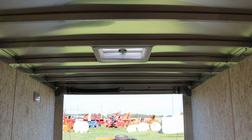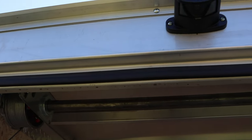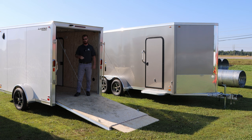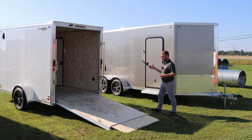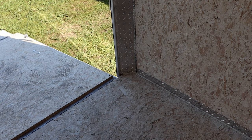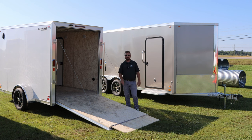The one thing to remember with a trailer is your height and width — they always talk about outside dimensions. So this single axle, you're going to be 78 inches tall. Tandem axles are the same. The ones beside us have increased height — 6 inches — so they are 7 foot tall, but you're going to lose 6 inches with this header. Whenever you talk about a 7-wide, 7-tall trailer, you're actually only about 6'8" wide on the inside wall to wall, and 6'6" on the door opening. That's something to remember when buying a cargo trailer. Also, the spring assists are the narrowest part of the ramp — so even though it says 7 wide, and 6'8" wall to wall, where the wall jets in you're less than 6'6", and even less at the spring assist on the ramp.